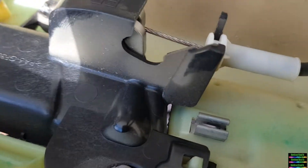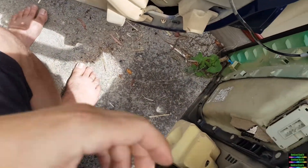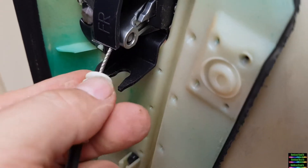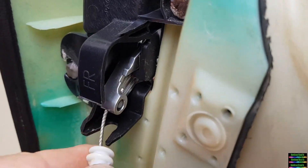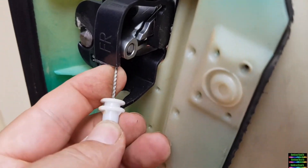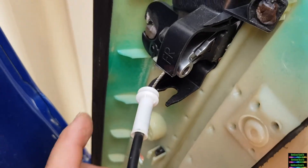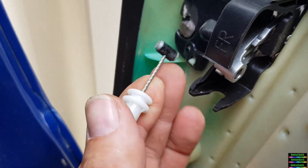That second one didn't seem to need to squash. So that looks like the door card off, and you've got a mechanism there — that's your door latch thing, so when you pull your door open it pulls up and down. And that cable — I reckon you just pull this forward, unclip that, and in one of the directions it should just pop off. It comes out the back and pops off.